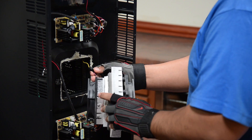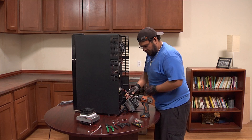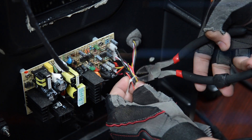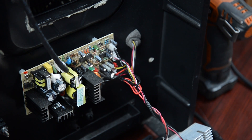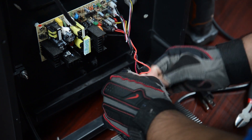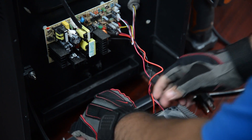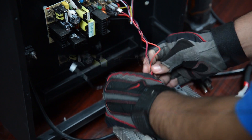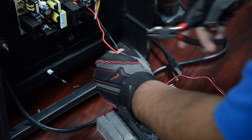Here's the cord. Unplug the cord and set the cooling kit down. We'll take our wire cutters and clip the zip tie, then unravel the wires. We can disconnect the NTC cable and the fan cable. We're going to be splicing the power cables with the new cooling kit — it's going to be the black and red wires.